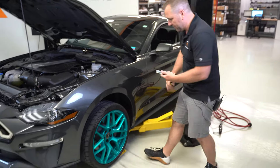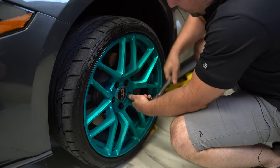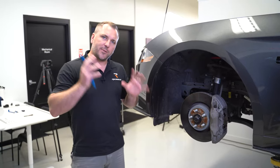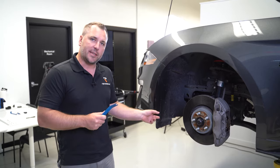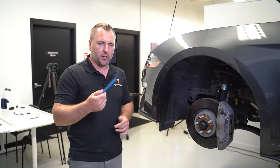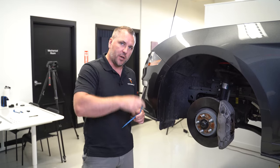After those front fasteners are removed from the top of the bumper, remove your front wheels — there's a lot of torque on those. Wheels are off. Next step is to remove the plastic clips on the inside of the fender liner. The best tool for this is your traditional interior pry tool.